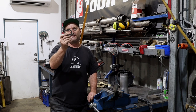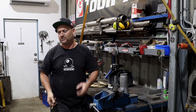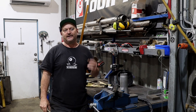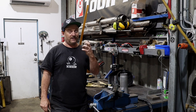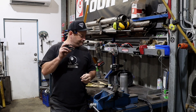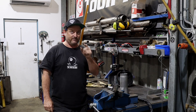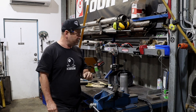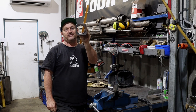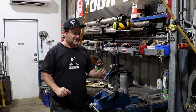If it's round, it's pretty basic. You can go oversize a little bit, say if your exhaust port's 45 mil, you can make a 48 mil header. That's not a problem. It's usually better to go slightly over on an NA engine, but not too small. It does not make your car more torquey having smaller headers. That is rubbish. The other things you'll need is obviously a collector, 4:1 on each side. In this case, if it's a V6, 3, whatever, very vehicle specific.